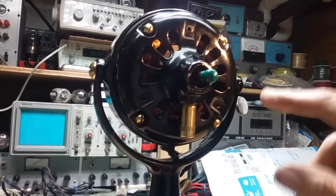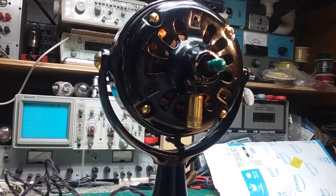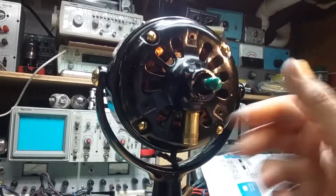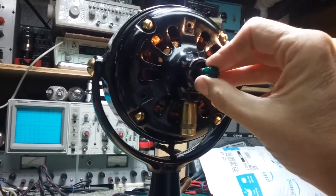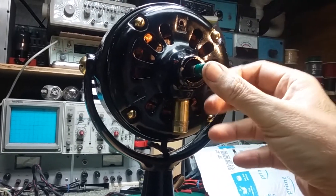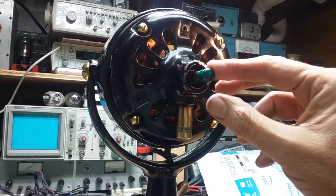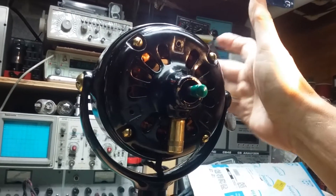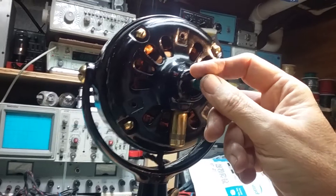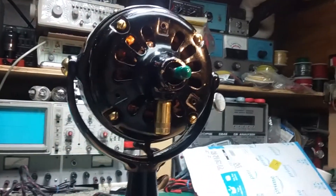If it stays standing up it'll probably be fine because the motor situates itself — the armature situates itself in the stator. I just oiled it, it's got new oilers and new wicks. It's only got an eighth of an inch of play so that shouldn't be the issue. I think it's only when laid on its side that it does something to the springs on the centrifugal switch where they probably don't make really good contact right away.